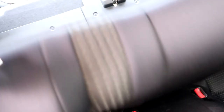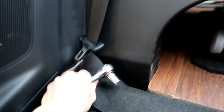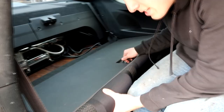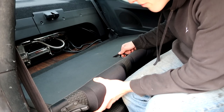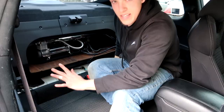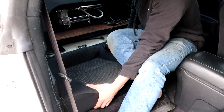Now moving to the back of the car, you're going to have to take out the back seats unfortunately to be able to take off the side paneling. The first thing you got to do is pull down your seats. Over here you've got a bolt — 12 millimeters — and then you've got the same one on the other side. That should release the back part of the seats. Now with those two bolts out, this should be able to slide right out. Now there's only one bolt holding in the seats to the floor and it's just this one bolt in the back — 12 millimeter again. After that bolt comes out, these should just pop up. If you're just tugging them enough, it'll pop right up.